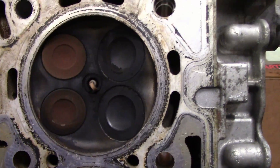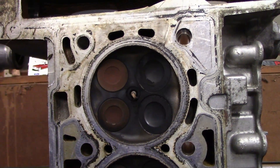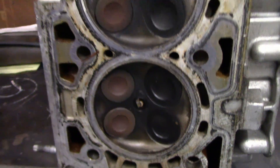To fix this, you take the head off, get the head machined, and either replace the valves, or you can get a 2003 through 2006 head and use that — you have to make sure to swap the cams out of your current head into that one. I actually replaced the head on this car, my sister-in-law's 08, with a head from an 03. We got all the machine work done, did new valve guides, put it in, and the car is running perfect — it's the blue car in my oil change video.